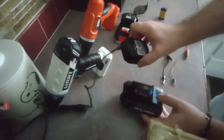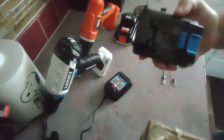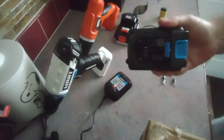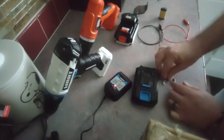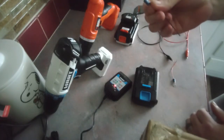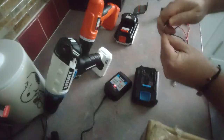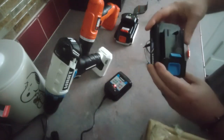So what you can do — mind you, it's fully charged now, which is awesome. On the battery you'll see the contacts; there's a positive and a negative, and you have to look closely on your own. All I did was jump it with a 9-volt battery. You can find other people doing this online, getting real fancy — all I did was take a plain old terminal connector, added some light-gauge solid-core wire, negative and positive. I used alligator clips to clamp to the ends for a little extra distance between my hand and the battery. On the battery itself you'll see two slots — a positive and a negative.